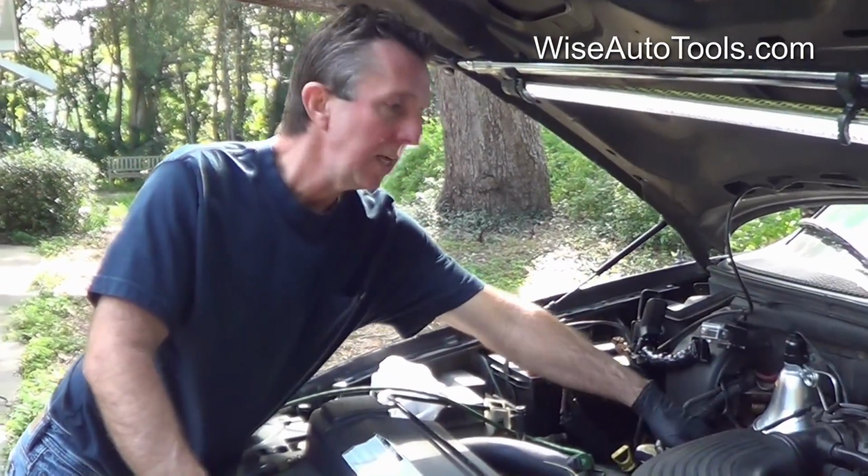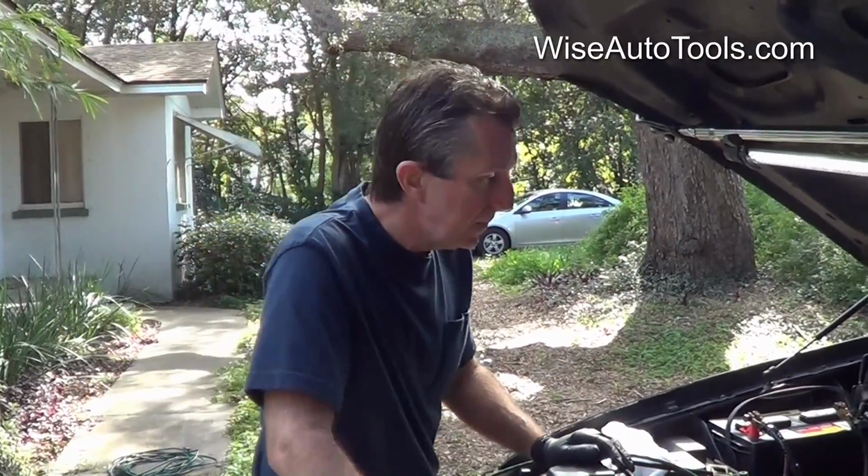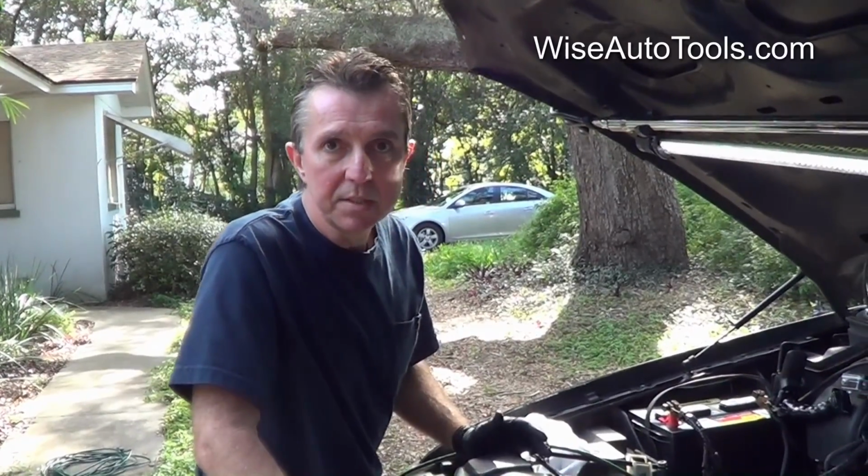Okay, we're doing a spark plug thread repair on a 1999 F-150 today. The one that we're working on right now is the second plug back on the passenger side, and we're going to be using the Time-Sert thread repair kit. It's the Time-Sert 5600. First step before we do any drilling or anything with the reamer is to make sure that the valves are closed on the cylinder that we're working on.